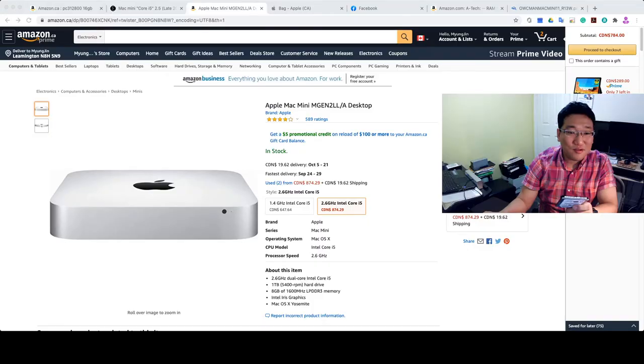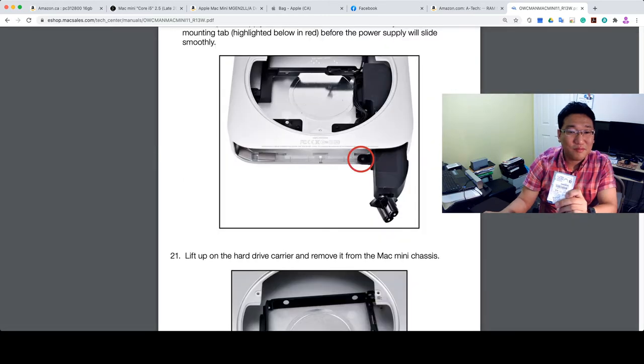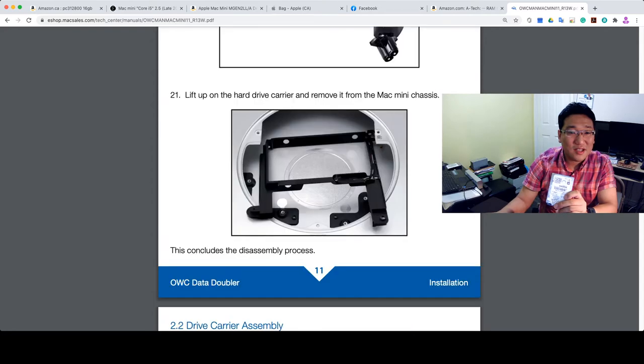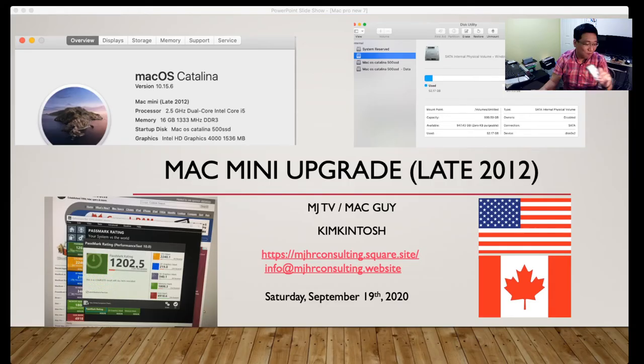My method for today's video is the highlight. I'm using an M.2 SATA converter with an M.2 stick SSD. That way, you don't have to open the logic board — you just gently slide it underneath. In order to upgrade your Mac Mini with a 2.5-inch SSD the standard way, you need to take out the entire logic board. But with my method, you don't need to do anything like that, which is beneficial for upgrading your Mac Mini.